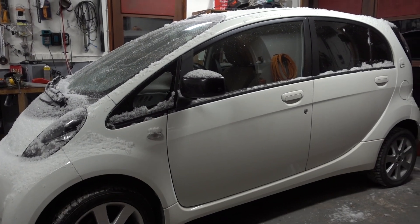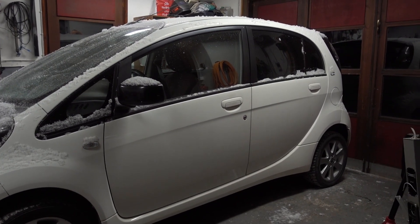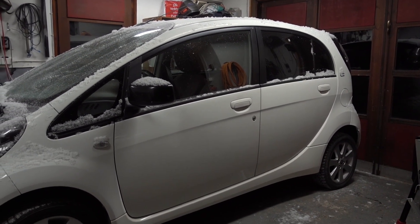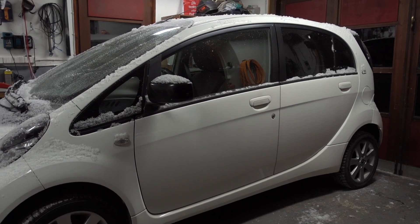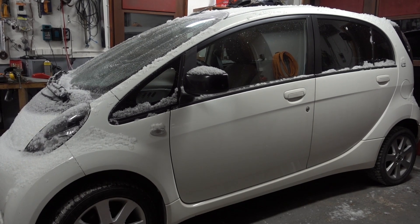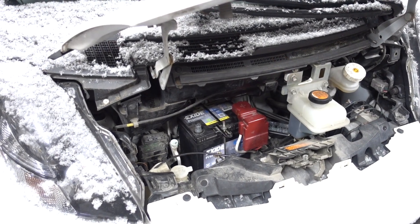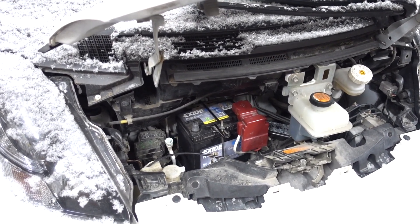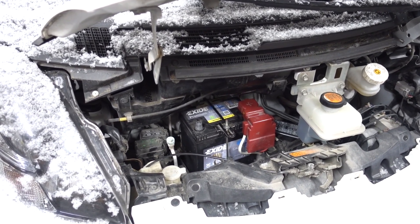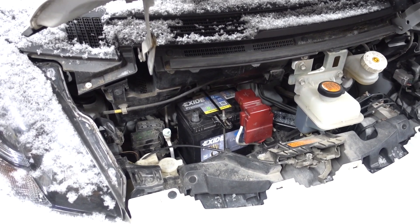I put the car into the shop and now let's investigate. The fault code basically said that there's an issue with the pre-charge resistor, abnormal voltage — it kind of aborts the startup procedure. There are a few things that could have failed, but let's start with the easiest. I checked the 12-volt battery and it was sitting at a quite healthy 12.5 volts, so it's not due to insufficient juice in this lead acid battery that the contactors won't work. We need to look elsewhere.